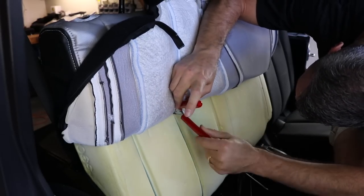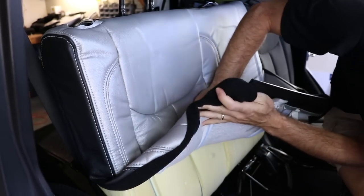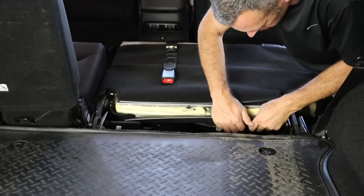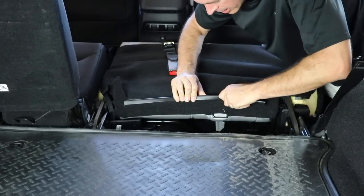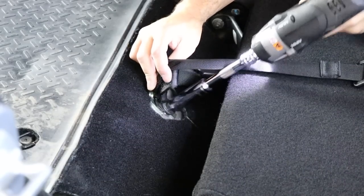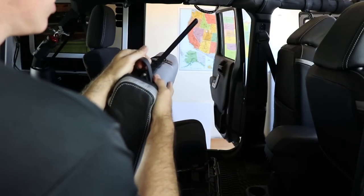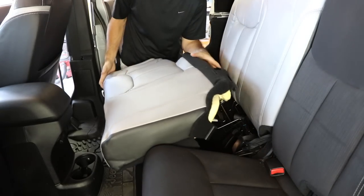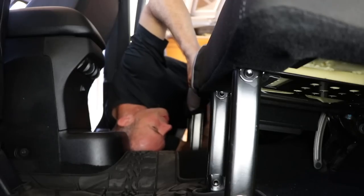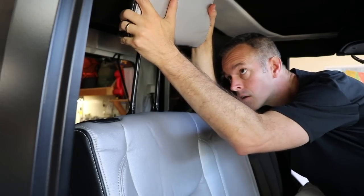Every place that you remove the hog ring, you just add one. Once the fabric is in place, you can tackle the U-clip and then you're done. Just zip everything up and reinstall the seat belt. Reinstalling the handle trim, just use the same method you did before — give it a good press and then slide it down. Now you're ready to reinstall the seat bottom. Just line up the foam, pull the fabric around and hook up all those clips underneath. You've got to make a couple holes for the headrest post to slide up on. Once the headrest is installed, you are all set.